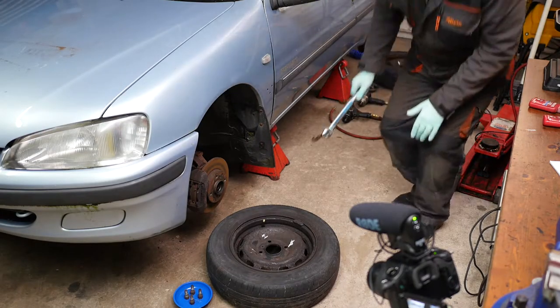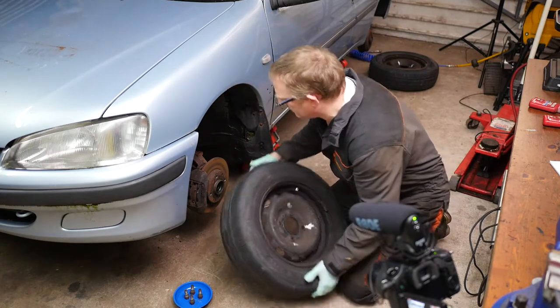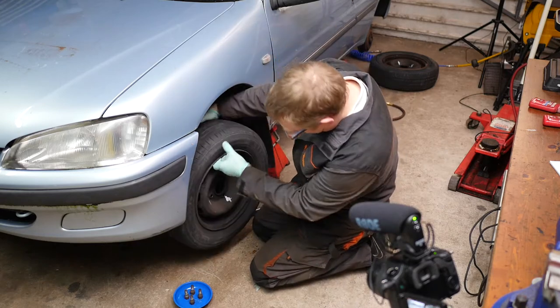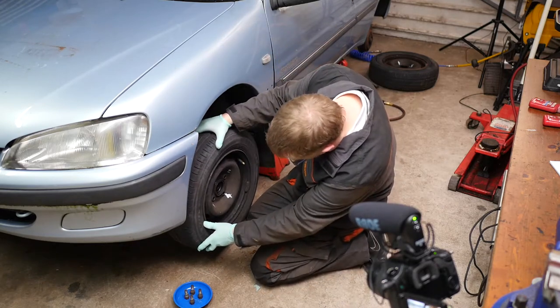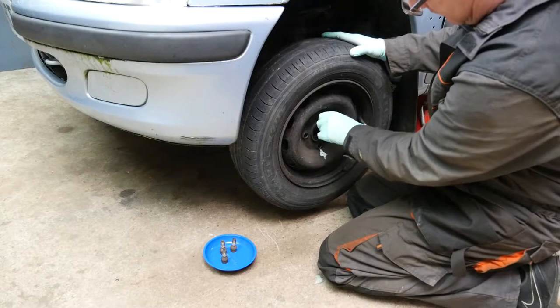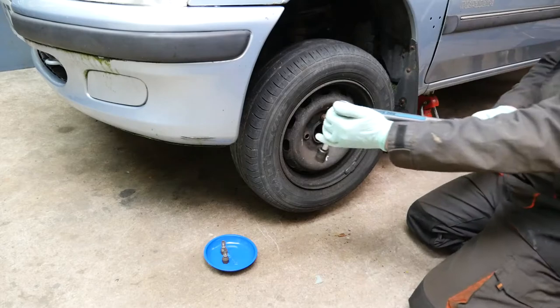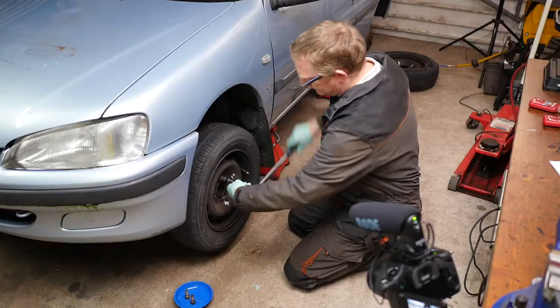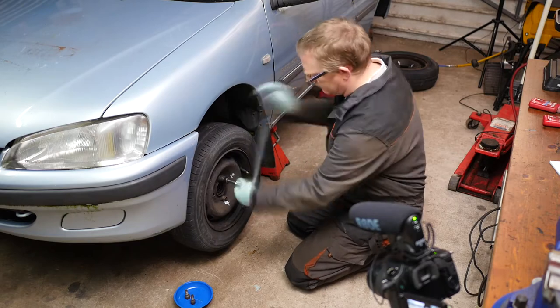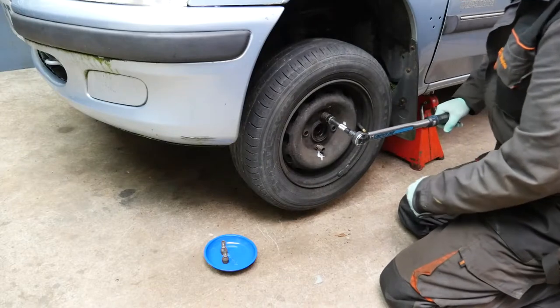Now to putting the wheels back on and tightening the eight wheel bolts. We'll start with the front wheel and we're going to do all these bolts to 85 newton meters, but we will be using thread lock and JB Weld on three of them. Bolt number one will have no thread lock or anything and will be tightened to the standard 85 newton meters. And there's our click.